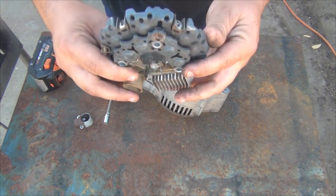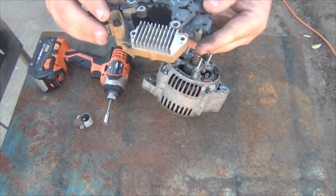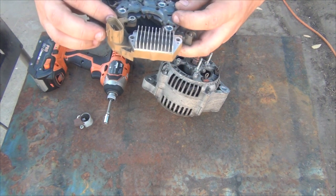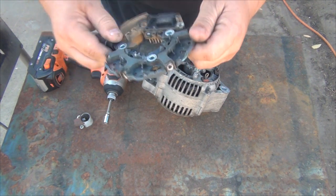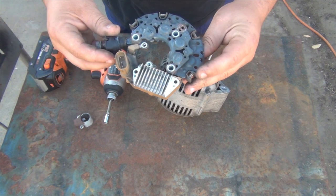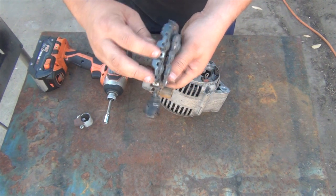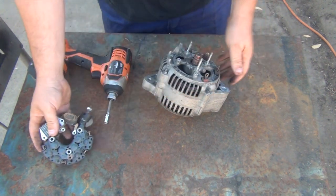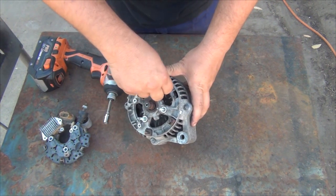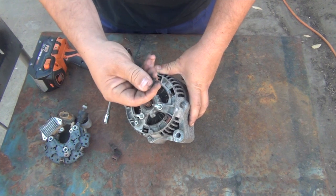People had commented that it was possibly one of these diodes in the pack that had failed. I can't see any obvious signs of failure, but with silicon it's not always obvious. It looks like there are eight diodes. There's also what looks like the battery terminal connection, and connections to the actual windings in the alternator — these ones here are insulated by what I think might be a silicone rubber, it doesn't feel like normal rubber. Insulators.